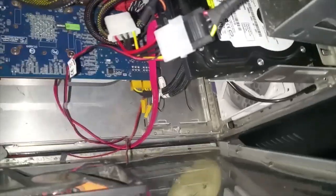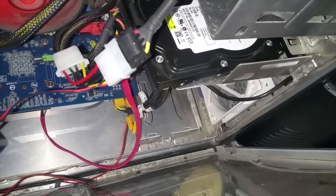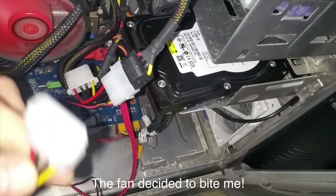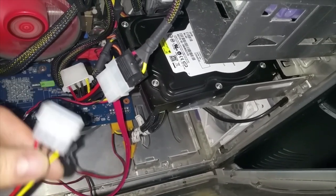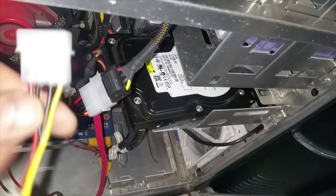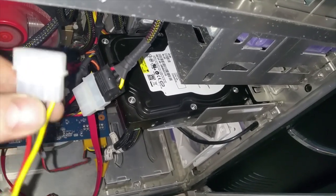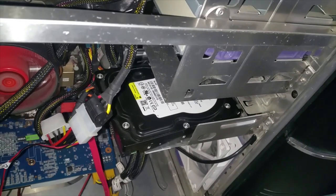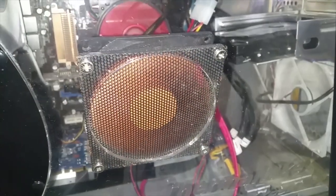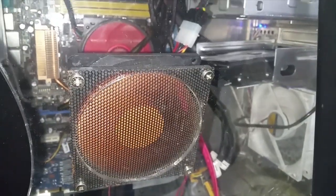But inside, you'll notice there's actually a power supply lead coming from out from the front of the computer, and the fan wasn't working, so I put a multimeter onto this. This is dead. This goes up into the front panel and disappears into the ether, so I can't trace this to see what's wrong, but it is decidedly dead. Fortunately, there's a power supply here for a hard drive that isn't in there with the current configuration. So I've managed to plug it into that, and now it's running quite happily. Got more case cooling.